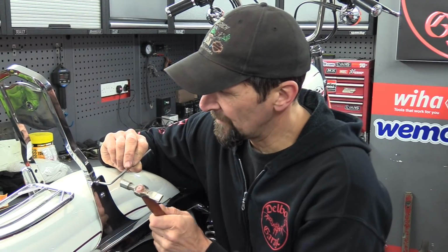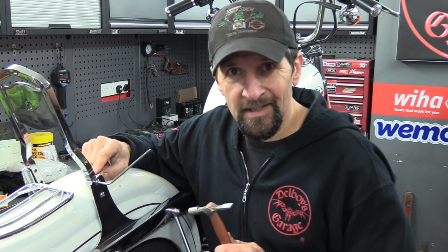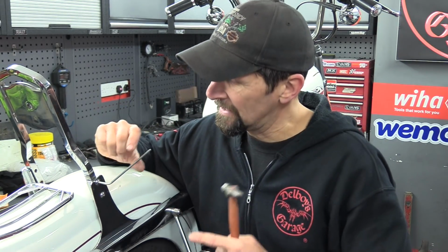Little trick if it helps you. These Allen screws have probably been in there for 19 years and don't look like they've ever been out. Not rusted as such, but the heads of them are full of polish and gunk and a little bit of corrosion. And you put these little tiny Allen keys in and then you try and twist on that, it's very easy to mince it out.